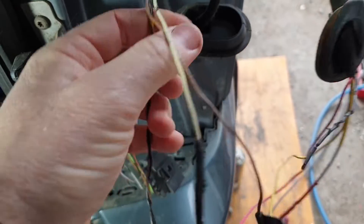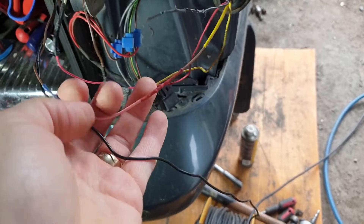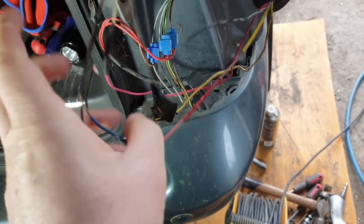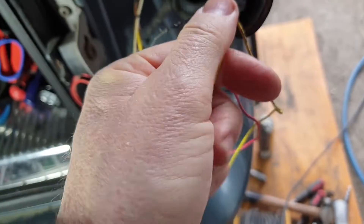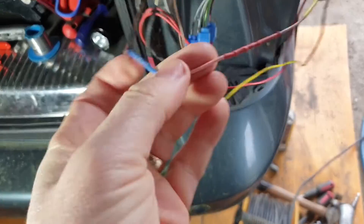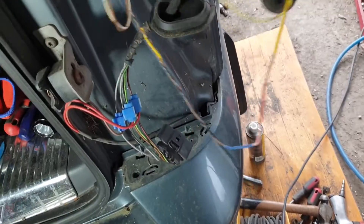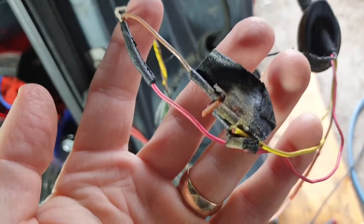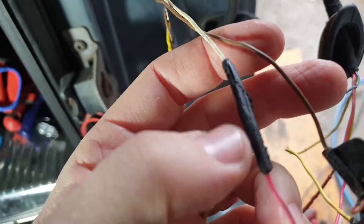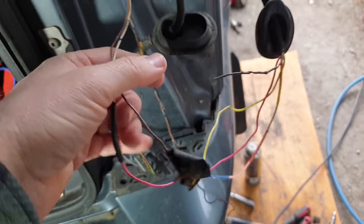What I've done is cut it right back to here — this is mine. I've retwisted them because these wires are actually twisted together. That's the black wire, this is the brown one — I've added a section of pink wire and that's my solder join there. I've got a bit of heat shrink where the wire was nicked, so I'll put a bit of heat on that. It just goes from there to there — chop that section out. I've also checked the wear sensors while I'm here, and just as well, because that's also the problem. I'll try and open that one up and have a look, repair it, re-tape it, and then put it back together.